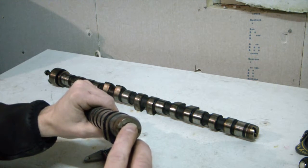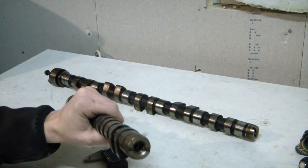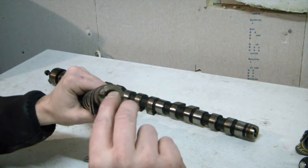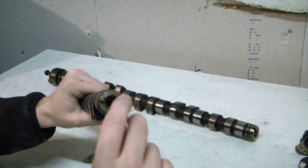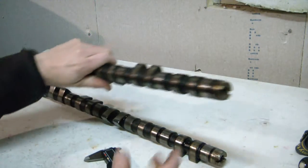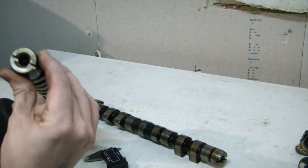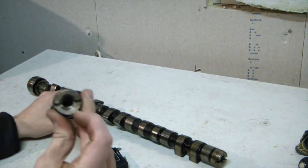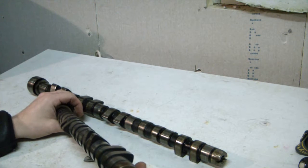I know it's a naturally aspirated one. How I remember that is that I think of all naturally aspirated engines as GLTs. So this PGE is a naturally aspirated exhaust cam, and this other cam says PHI. So the H is actually the turbo cam.